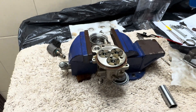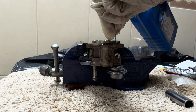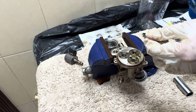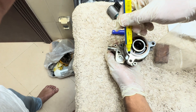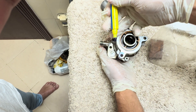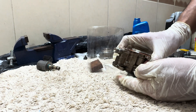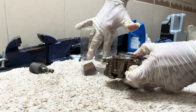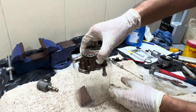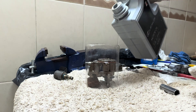Now it's time to take the side out. Before that, just fill oil in the diaphragm part. This is just to show you where the diaphragm is and where the hole is for the diaphragm. That one is the hole for the diaphragm. Now, after putting the top part, mark this particular side so that you know which hole goes where — otherwise you'll find it difficult when you dip the whole unit in oil. Keep a piece of wood or something to level it properly.